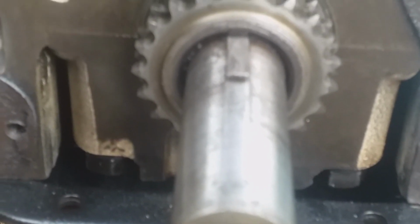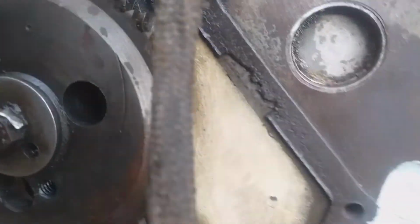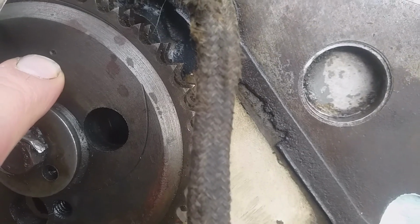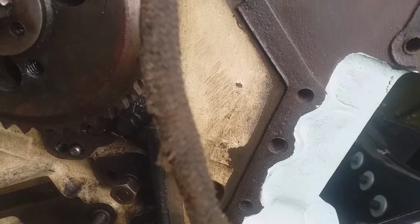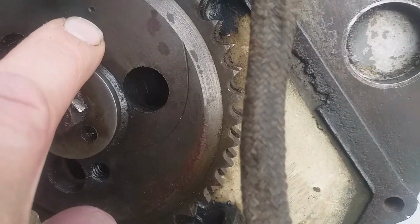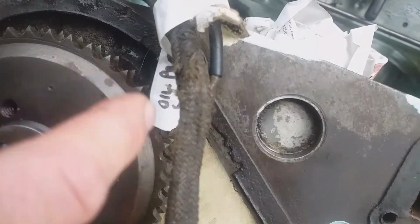So down here, that's what the crank looks like when she's at top dead centre on number 1. So the timing marks, let me take you over to where the timing marks are. Can't get in there. Well, they're underneath that timing mark cover, because I've just put it back. Now on my wheel, someone's put this mark, which corresponds to this mark, I've noticed. But I'm not going to do it that way, because it is guesswork, there's no alignment mark. I mean, this could be to that hole, it could be to something else.